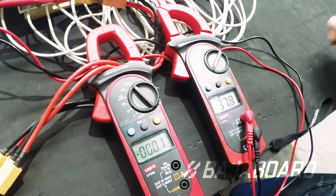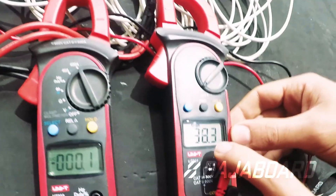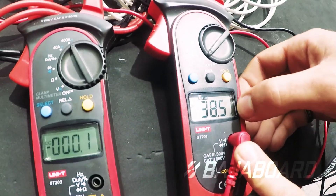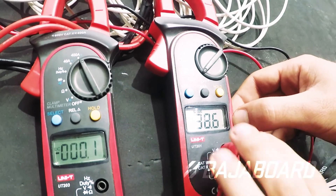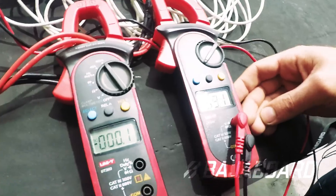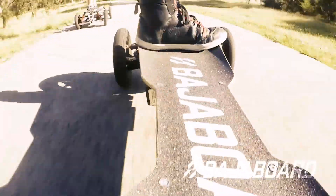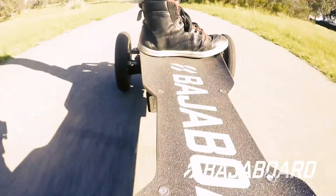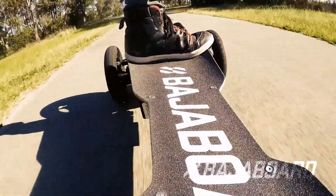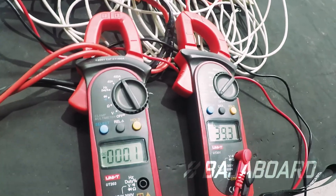There we go. Now slowly the voltage is going back up, as you can see it's restoring to whatever charge is left. To give some point of reference, cruising around at a steady speed of 20 km/h you're only drawing about 10 amps. So it's highly unlikely you'd ever need 100 amps or even more for a continuous period like that. Now we're going to show a slightly better case scenario at about 50 amps.